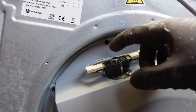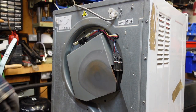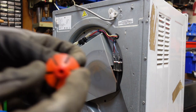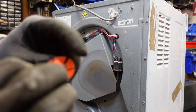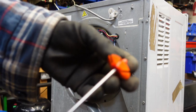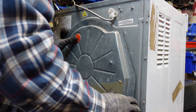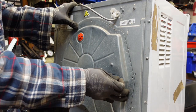And then up on top here, this fellow is a thermal trip. If the machine's not getting hot, the first thing you do is press that button — you may have to take the back off to do that. But there's also this red button on the back here. It's got an O-ring on it. It looks like it's in two parts, but I can only see one of them. So it might be possible to push this in with a screwdriver or something. Screwdriver goes into it but it doesn't seem to do anything. Maybe you do have to take the back off. It is sitting on the thermal fuse, so maybe you just put it in and wiggle it. Let's put a screwdriver in and wiggle it. Right, I'll put the back cover on and we'll give that a test.